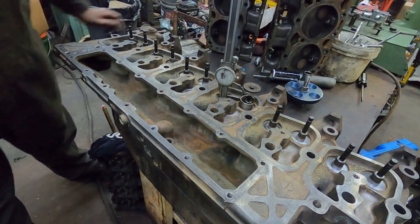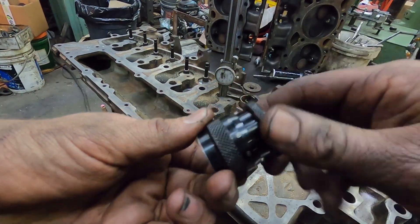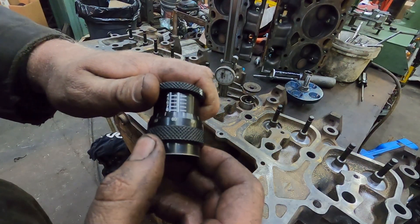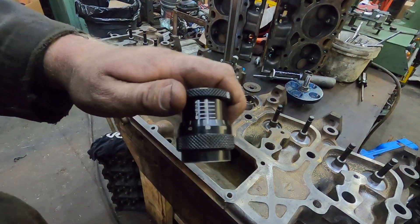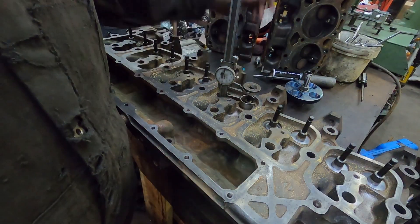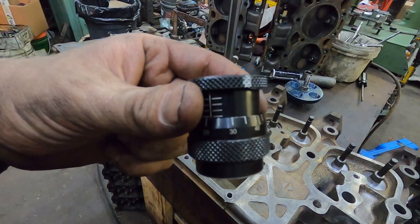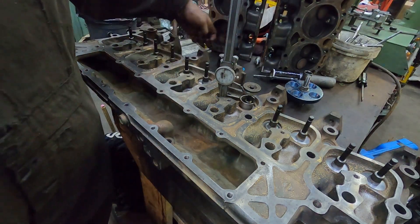Another way to do it is you can buy this style gauge - basically the same idea, you just come out and read it. The only thing with this one is it doesn't go high enough; it only goes to about 800 to 850 thou. So if you were going to use this one, you'd have to put something underneath it - like a shim or some valve spring shims - and stack a bunch of those, or get one that goes to two inches. Something else you can do is use a snap gauge to do the same thing. It's a little bit harder and I personally don't use it this way often, but you can basically use a snap gauge to get in there.